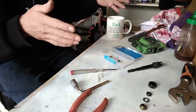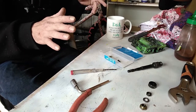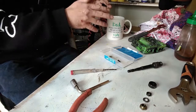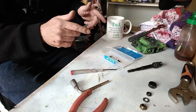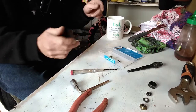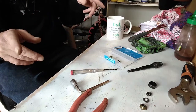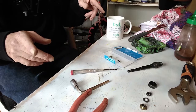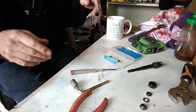You can grab your axle, your rags, degrease everything. Get your pedal, degrease inside of it, and chuck your bearings in for soaking. Now, how do I do this? Let's just do it by magic.